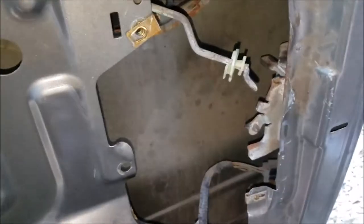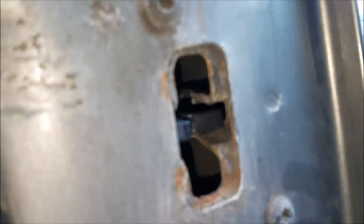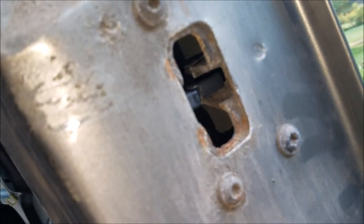So I'm going to have to replace this whole mechanism — it's these three screws, star tips. Pop those out, one, two, three, then put the new assembly back in and you'll be able to open and close your door again. The only way to really get the door open again right now is to get your cable released and then push on this thing at the same time, and then you can open your door.